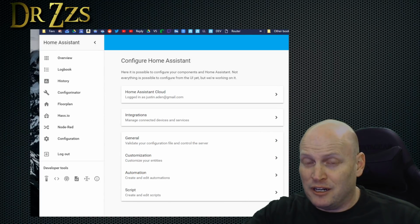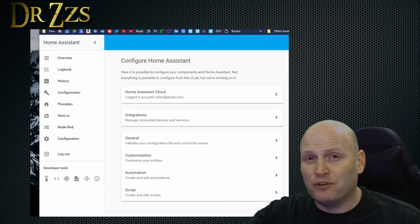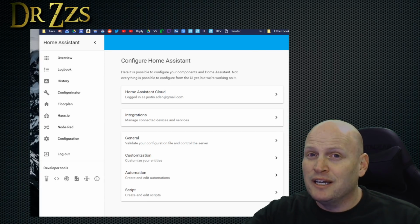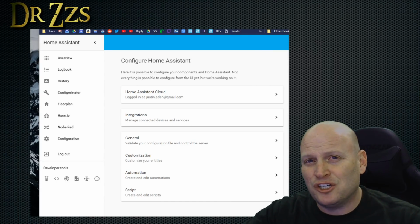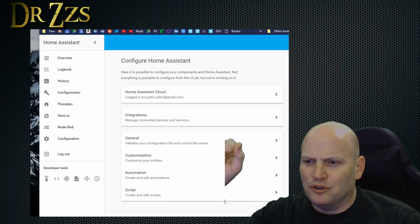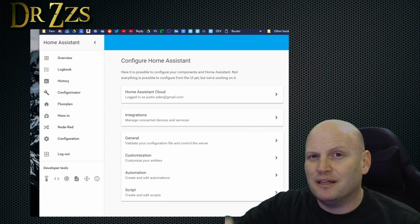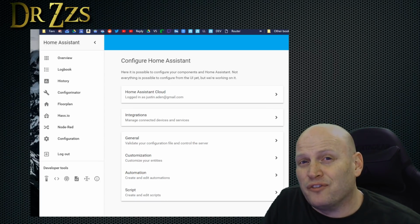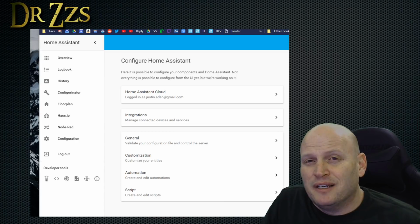Now, if you do set it up through the eWeLink app and you look at your firmware version and it's 1.5 or 2, then you should be able to do it. And then if you're getting stuck at final stage, it might be a firewall issue. So just find every way you can to shut off any firewall that you have at all on that computer or your network or whatever. And that might help. But my guess would most likely be that it's the default stock firmware that you have that's causing you the problems.